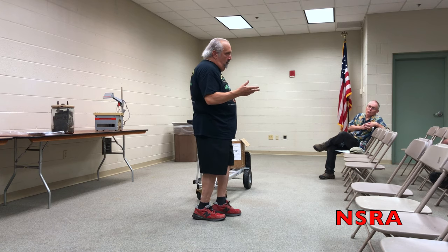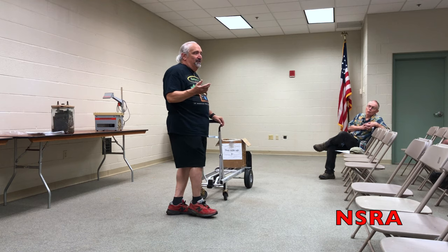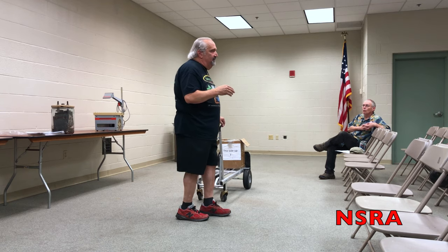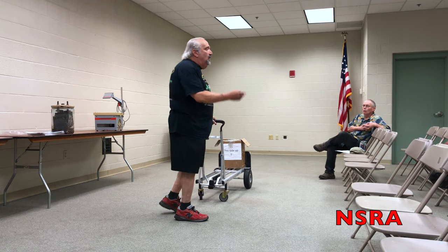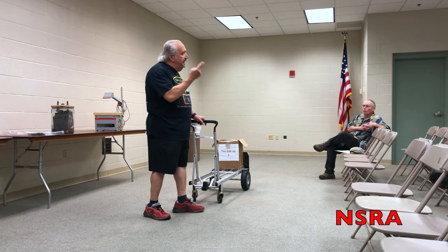Two of our markets that we do really well in are Florida and Arizona. Because you're torturing your battery when you're at 120 or 130 degrees in your garage, and the water evaporates. So people ask, what else can I do for keeping my batteries alive longer? I say move to Hawaii. They love Hawaii because you've got 70 to 80 degrees and humidity, so you're not going to get evaporation, and that's how to make a battery last a long time. Keep it between 70 and 80. Well, that's not the real world. So in Arizona, batteries die prematurely because of evaporation and heat.